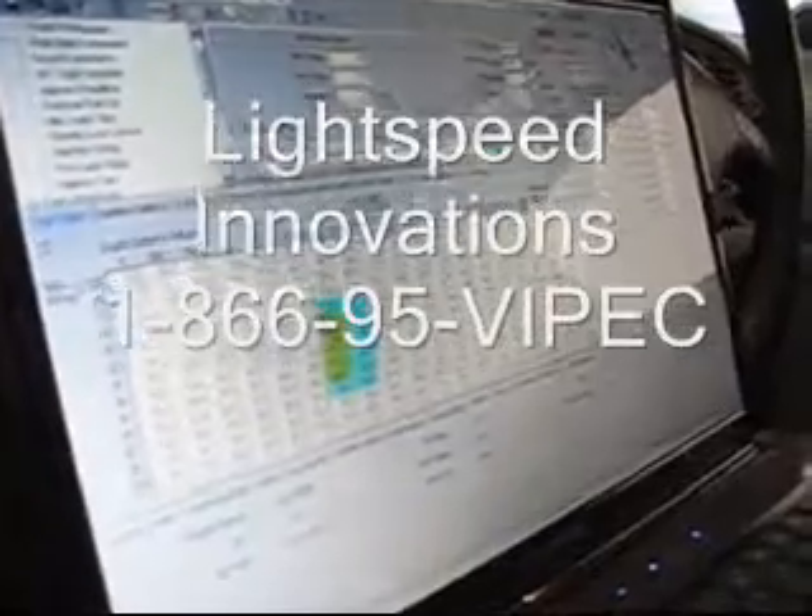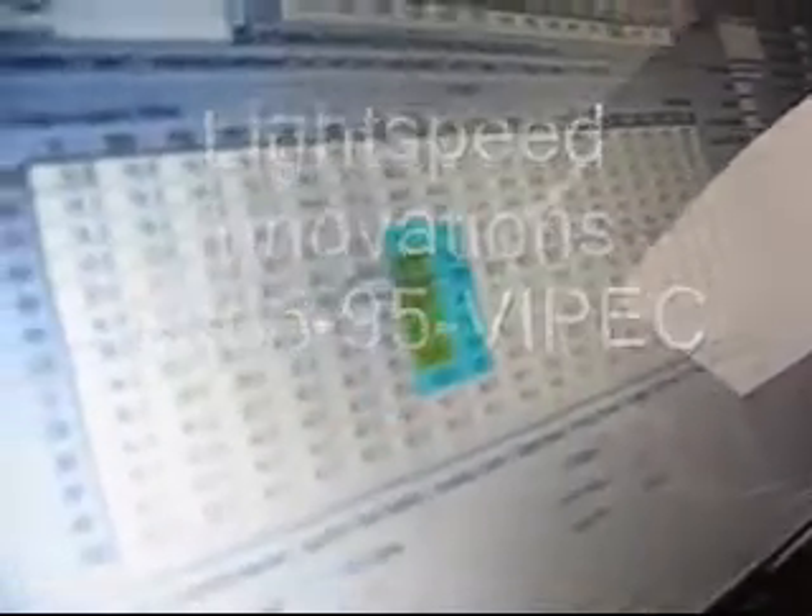I know most people are sitting there saying they can't believe they just saw that happen, but it really did, and here it is — it's tuned. We're now going to move on to the 2500 range. I'm not going to readjust my 1800 bottom line because I'm actually going to try and get some of these lower cells with a little bit of load so that I can get more drivability out of it.